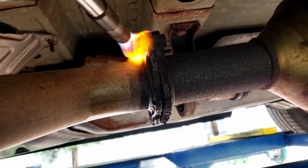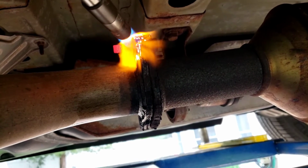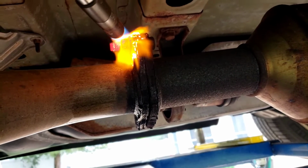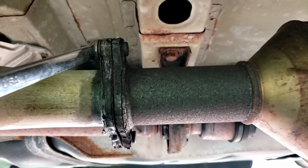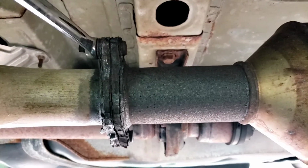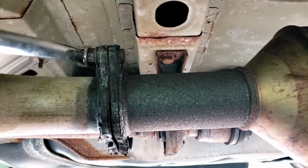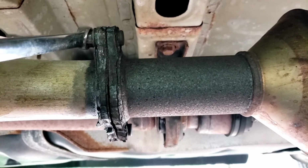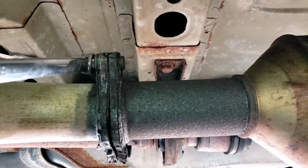Here we are with a propane torch. I'm going to torch that nut to its cherry red, or at least close to it, and see if we can spin it off and save that thread. Whew. Listen, nothing beats an acetylene torch. Gets hot really fast, but it's a portable propane one, so I could work with it here, people. That's for the DIY people. Alright, but we're going to work on this.